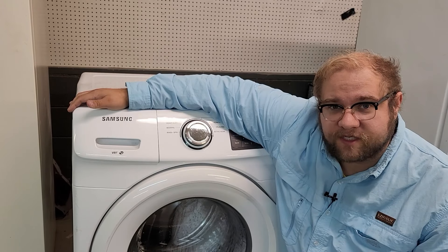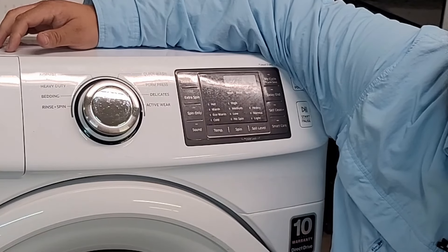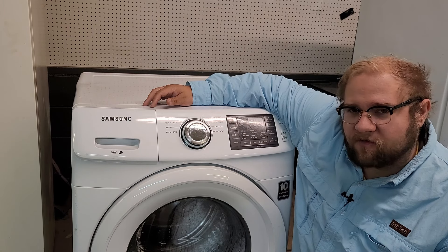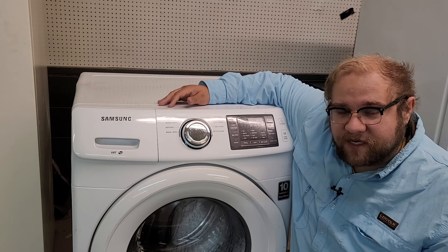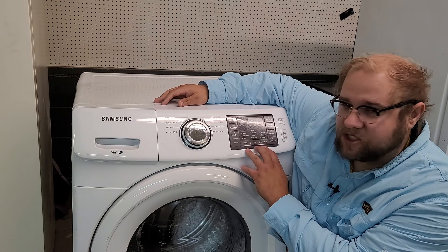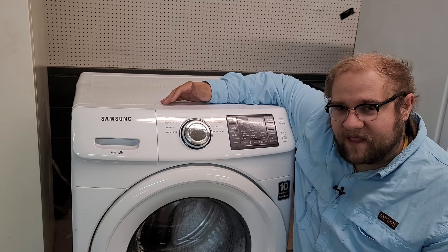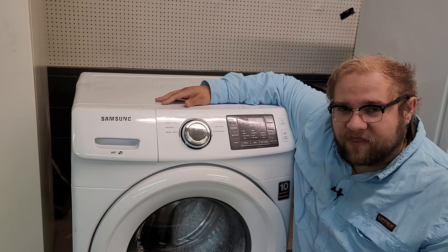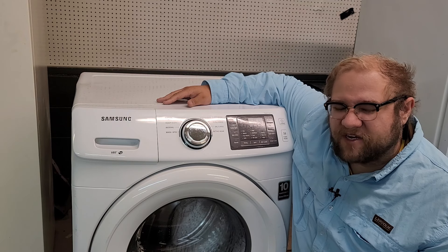Hopefully this video helped you with your Samsung washer — figuring out what the error codes mean and how to get into the test modes. I will mention that I had a little trouble with this one; I had to enter diagnostic mode two or three times to get it to respond to commands. Even the official technician's manual notes that due to the touch screens, it may take two or three attempts before the mode becomes responsive. All I did was turn it off and back on — no need to unplug it. Hopefully this helps you get your machine back up and running. If not, try a different brand like LG or Whirlpool. Have a great day.